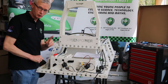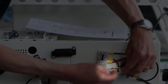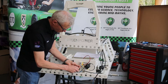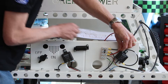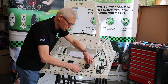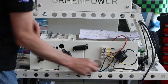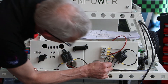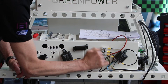Eagle-eyed viewers may have spotted something went wrong when I was fitting these cables in the bottom right of our connector block - the brown wire came out of the hole with G2B. I thought I'd done it right, I gave it a little tug and checked, but clearly I was wrong, so I'm just going to redo that one. It's worth double checking. With the bare wires like that brown wire, it's always worth checking that you haven't pushed it in too far, and that the screw is connecting to the conductor, not the insulation - because then you won't get a good connection. I gave it more of a tug and it's more secure now. The blue lead from G2L I'm going to connect to the remaining spade terminal of the right hand relay - it has a little piggyback connector, so we will be putting another lead on there shortly.